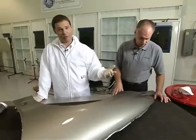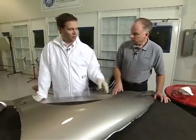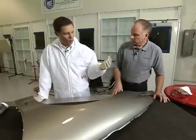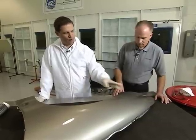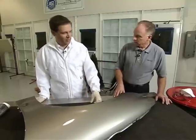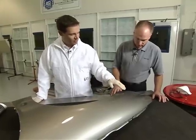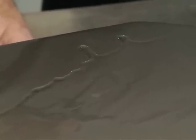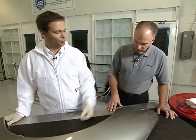Technicians have fears they express about sanding out imperfections such as runs and sags. Their biggest dilemma, they say, is not 'Will I get the run out of the fender?' but 'Will I have sand-through someplace — will there be an area where I will have sanded through?' And usually the answer is yes, and that's their biggest fear. By the time they get the run flattened out, they have sanded through right below it. And a sand-through means a redo.